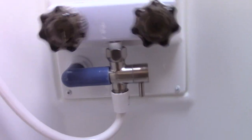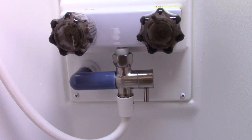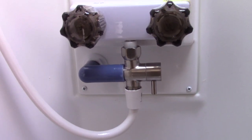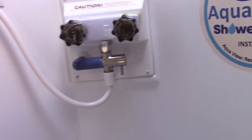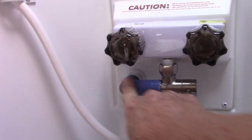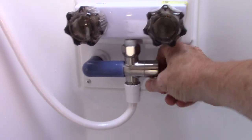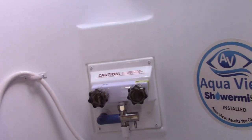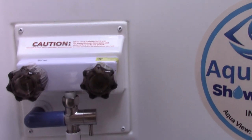Your shower has a shower miser — it's a water recirculator. If you're in a drought area like California, it keeps you from wasting water while you're heating up the hot water and purging the cold water from the lines. It'll just recirculate the water around and around — it doesn't use new water and doesn't dump old water into your gray tank. So you're saving space in your gray tank plus saving water. To recirculate, you're doing this. After the light changes to a deeper, brighter blue, that's telling you it's hot — then you go to normal shower mode.